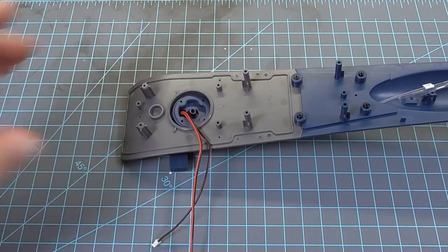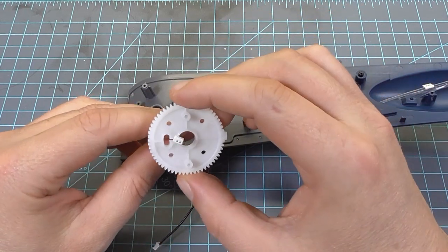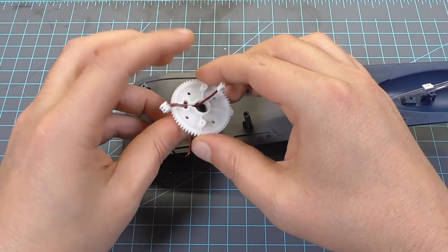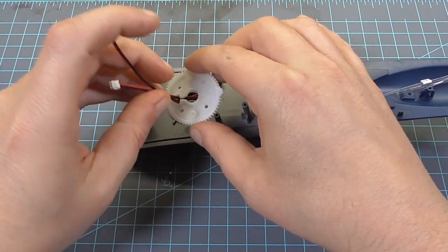If you're having difficulty getting the screws in, a little bit of dishwashing liquid on the screw helps to get them to cut the thread into the plastic better and to tighten properly. Don't use any kind of oil as some oils can react with the plastic.